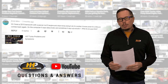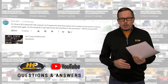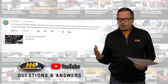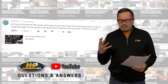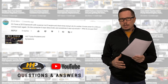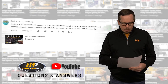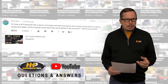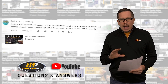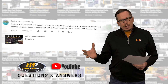Eric, I would tell you that we probably break this down into two possibilities. We could have a mechanical problem or we could have an electrical problem. The trick is to take that code and determine if it's referring to an electrical problem or a mechanical problem. On your turbocharger you've got an ECM that's controlling an actuator.